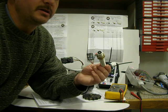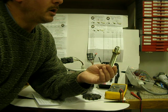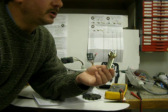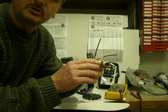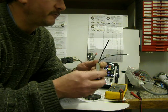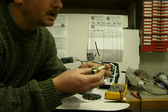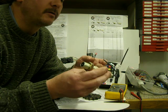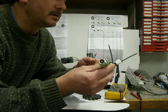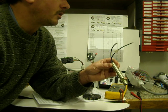Another problem is people thread these in and they get damaged because it hits the flywheel. Or I think due to welding, jump-starting, or for whatever reason, that real fine wire in here pops like a fuse. And when it pops like a fuse, this thing's an open circuit — it can't generate electricity anymore. Nobody really has a definitive answer for what makes them go bad.